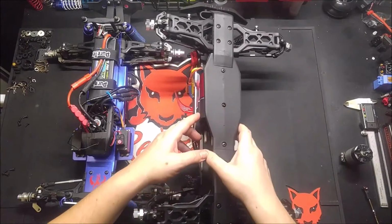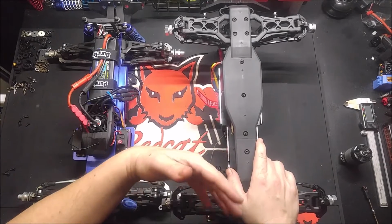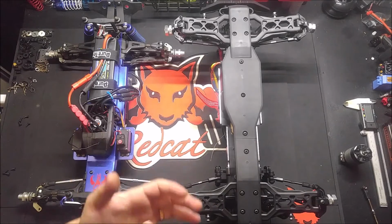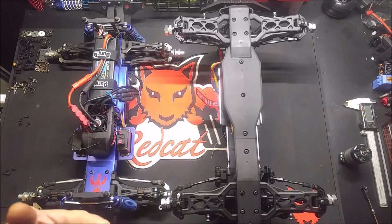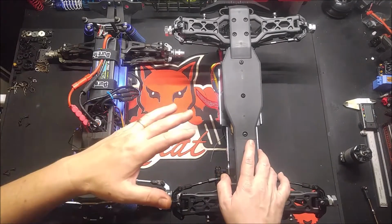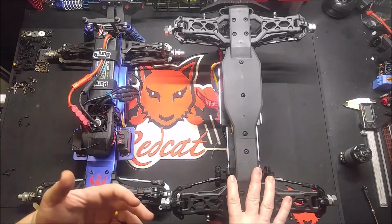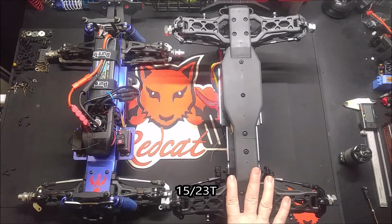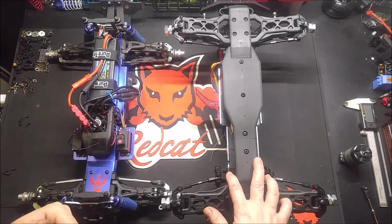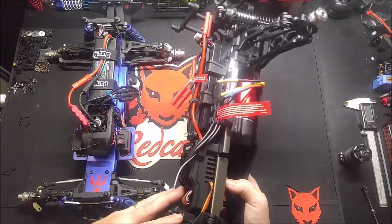The reduction gears and things like that, you can only change the spur gear and the gear it meshes with, and that's it. The other two stay the same, the spur gear and the other gear they mesh. They'll always be plastic on plastic, but the upgrades obviously give you a chance to do the steel as well. So you got down gearing and you got up gearing. I sell kits that simplify it for you and give you a little bit of a discount. If you want to go down, there's the 1515, I think it's the down gear, and then you got the up gear, which is the 1820, which I do not recommend anybody running on the stock setup.